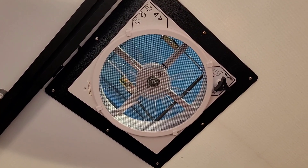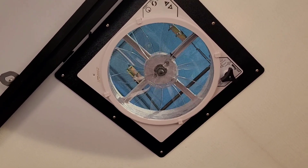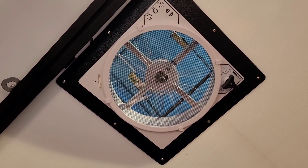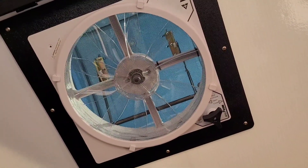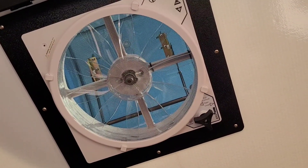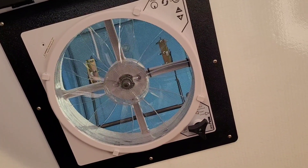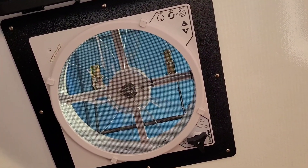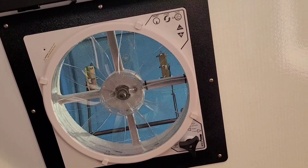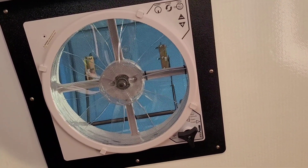Most of the time the fan runs at about 0.1 amps — that's only about 1.2 watts on low. People have told me that running it on speed 1 or 2 while sleeping is great for moisture control and preventing condensation. Even in summer they're only running it at 5 or 6, which is about 1 amp — 12 watts — so you can run it all night long without significant power draw.